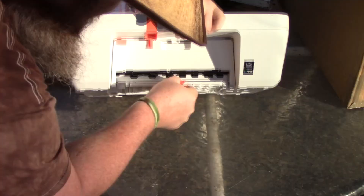I wanted to apologize for not showing where the print cartridges go. If you look at the picture — it's a bit fuzzy but it's the best I could get — there are two orange pieces of tape. Take those off, and look directly in the middle of the printer where there is an indentation. Put your hand there and pull that flap down. When you do that under power, the cartridge holders move from the middle all the way over to the right side of the printer where you install the cartridges. The one on the left will be the black cartridge and the one immediately to its right will be the color cartridge.